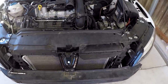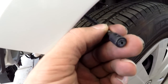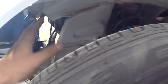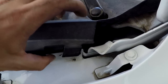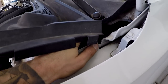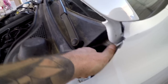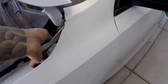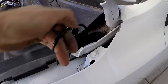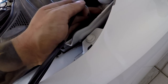Before putting the rest of the front end on I have to install the hood latch. The hood latch cable was cut — somebody decided to cut or chop it. I have to take the old one out; it runs through the inner frame and ends up over here. I don't want to remove the whole hood cowl so I'm going to slip it through that grommet. I've already disconnected it from the latch inside and now I'm pulling it out.